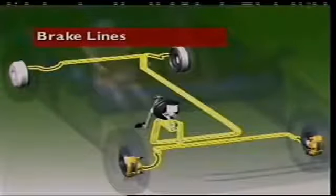This section examines brake lines. Brake lines carry brake fluid from the master cylinder to the brakes; they are basically the same on all brake systems. For most of their length they are steel and attached to the body with clips or brackets to prevent damage from vibration. A flexible section must be included between the body and suspension to allow for steering and suspension movement. These flexible lines are made of reinforced tubing to protect them from objects that could be thrown by the tyres. In some vehicles the brake lines are inside the vehicle to protect them from corrosion.